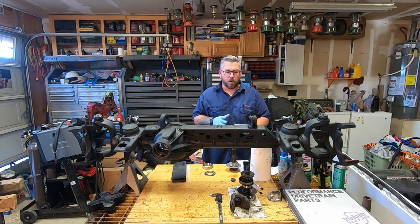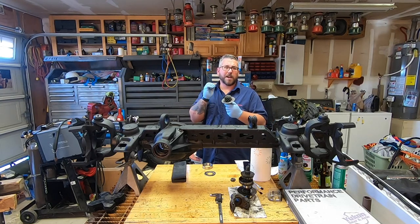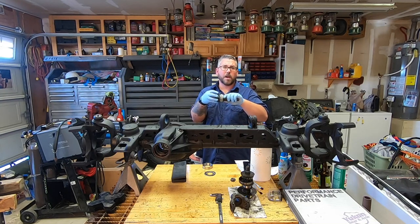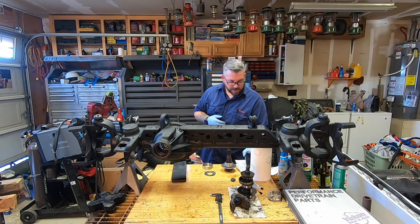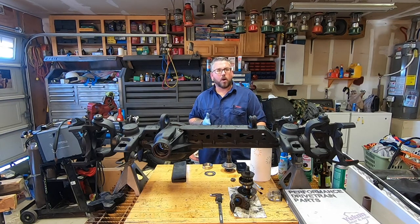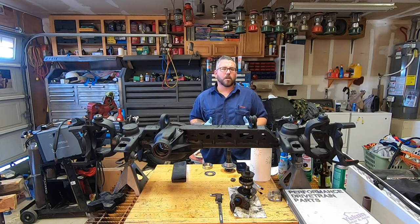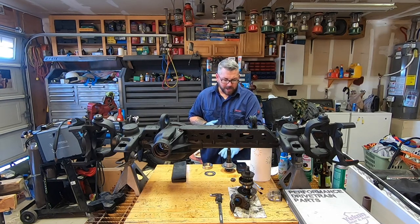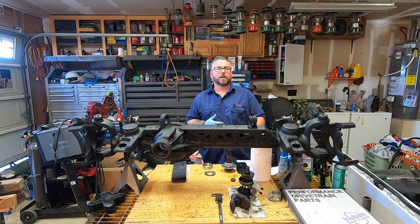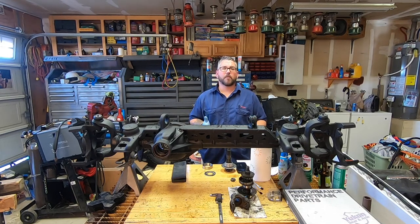I've seen it advised just about everywhere to start with the original shim sizes and then work your way forward or backward from there. So I've measured my new oil slinger as well as the old one that sits up against the pinion gear itself, and I have a difference of 30 thousandths of an inch — the old one measured 0.06 and the new one measured 0.03. The old shim behind the race measured 0.016, which reaches a grand total of 0.076. My new oil slinger is 0.03, so I take 0.03 and subtract it from 0.076 — that gives me 46 thousandths. So behind the race, I need a shim of 46 thousandths to match what it was originally.